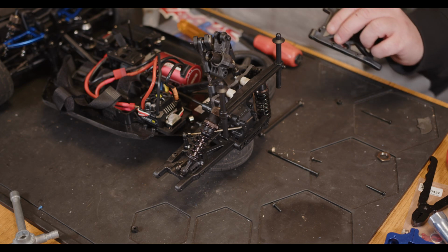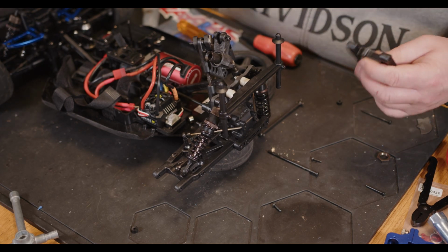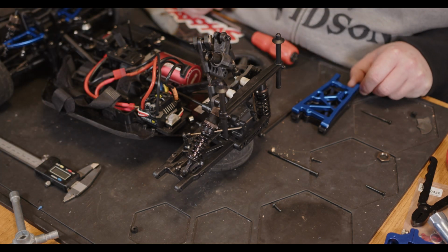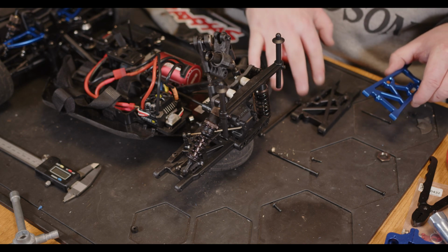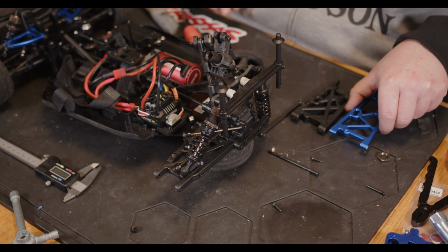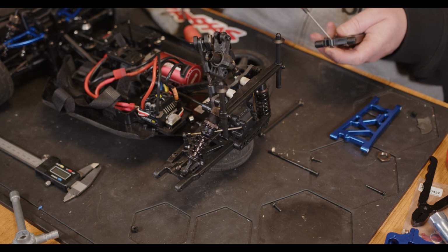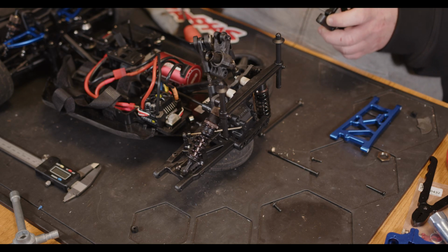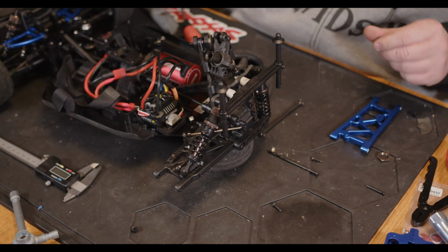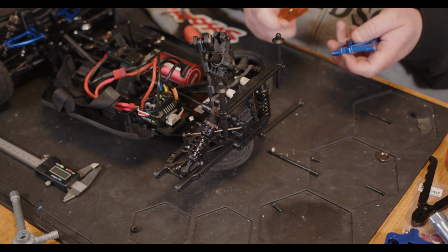And then the last final thing we're going to have to look at is the droop screw. So it looks like they're set at 3mm. So it looks like the dimensions are about right. The only thing missing is these two holes, but we're not using them for anything at the minute, so we need to get the droop screw out, and that's going to be a 2mm hex. It looks like these are threaded, so that should help us.